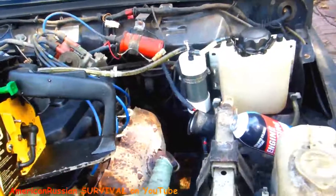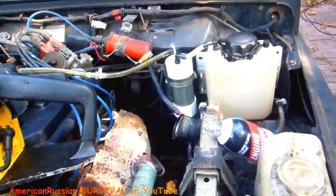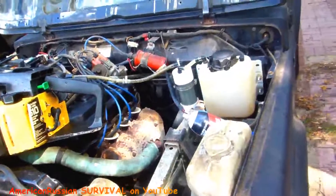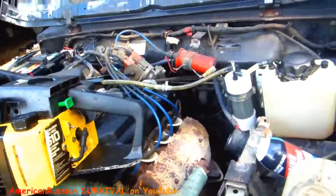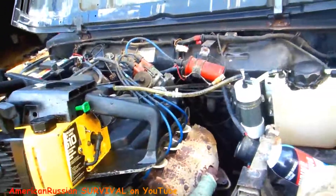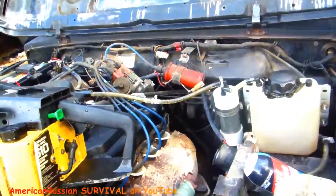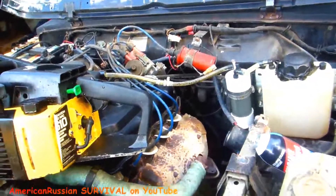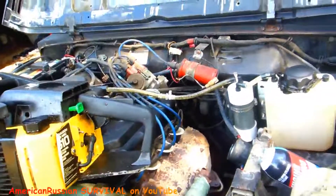I don't recommend this for a computerized car that has an engine management system and fuel injection - I don't think it does anything for that. Getting real technical with Stanley Meyer or Genepax or something - they did find a way to mine hydrogen from water really efficiently, but this simple setup is not adding more fuel. You're not getting free energy. The only way this is giving you more mileage is that this carbureted system, while pretty efficient, is not as efficient as a fine-tuned electronically managed computerized fuel injection system. What it's doing is causing the unburned gases to burn more completely by adding a little more hydrogen - that's why this works on these old carbureted engines.